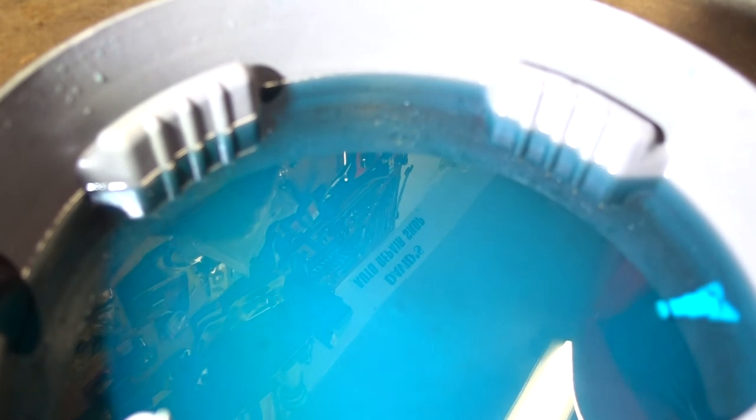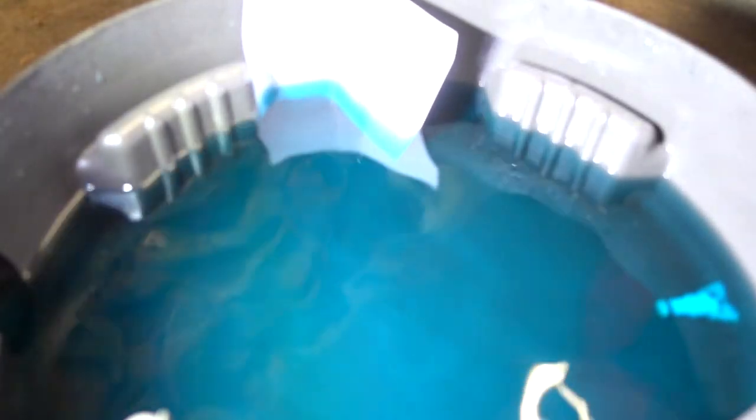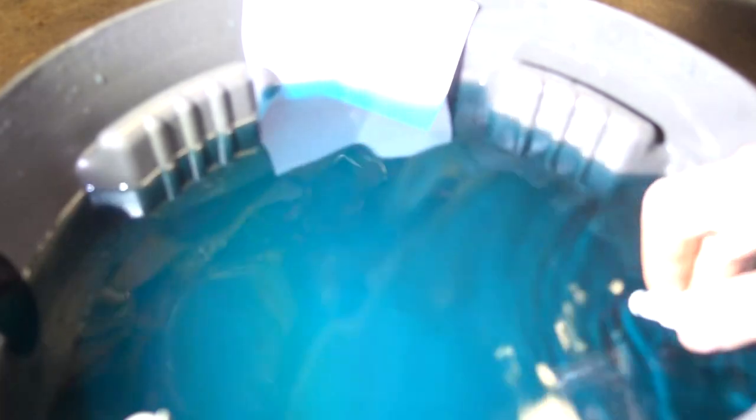There's the water flush I just drained out of the engine. You can see there's a lot of blue in there — that's how much antifreeze was left in the engine block after draining the radiator. There's the petcock.